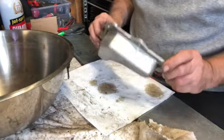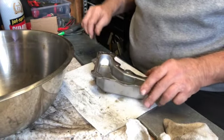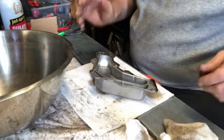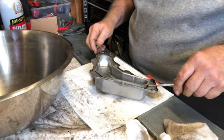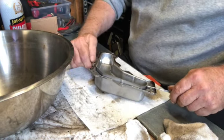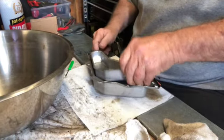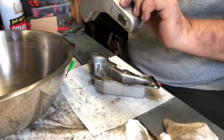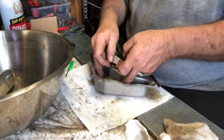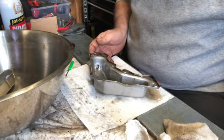Okay, I'm going to be cleaning out this valve cover for this Courage. You want to get something underneath. This has two walls. Try not to bend it. Just get a couple screwdrivers. Try to center up. It'll come out. Once you have this piece out, this has a reed valve back here in your bucket. It also has this sponge thing. We'll put that on a paper napkin.